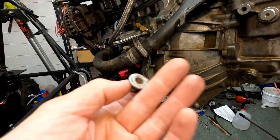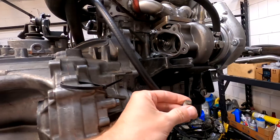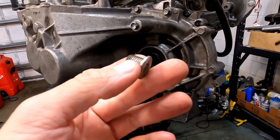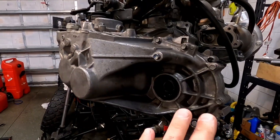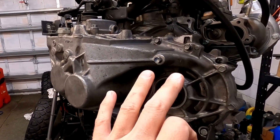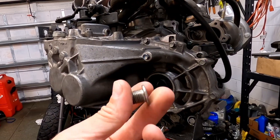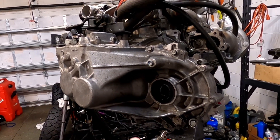This plug gets installed inside the bottom end in one of the oil galleys. The scary thing is because it was only the one plug missing, I was getting enough oil pressure to look like the engine had been assembled properly - I was getting just a couple of PSI. So another two days down the drain. But fortunately we did postpone the Durham town trip. I spent the day pulling the engine out, getting the oil pan removed. No oil plug means no oil pressure. Let me get this guy installed and we'll keep moving forward.